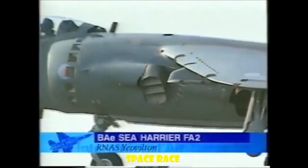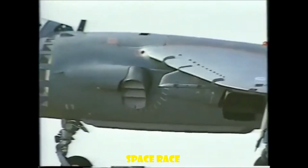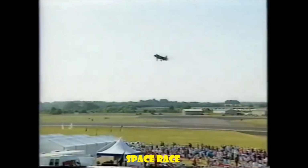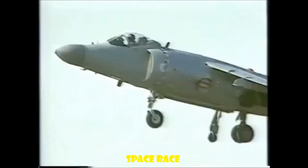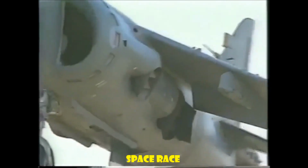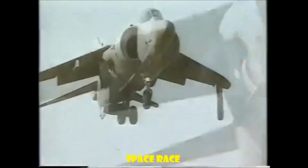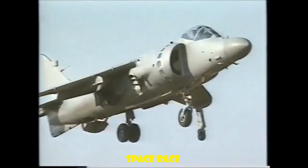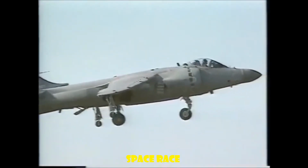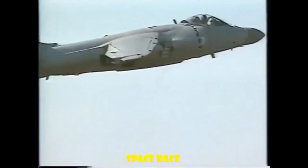And you use your stick just like a Hunter pilot would in flying straight and level, when he keeps the airplane flat. And you move it forwards and backwards to keep the airplane flat in pitch as well. And although your aerodynamic surfaces are not doing any good in the hover, because there's no wind going over them, at the end of each aerodynamic surface is a little rod which operates a reaction control, a little puffer jet at the wingtips, the nose and tail of the airplane. So the pilot doesn't have anything extra for reaction controls. He waves these aerodynamic controls around in the hover, and the little puffer jets do their thing and control your attitude. It really is that easy.